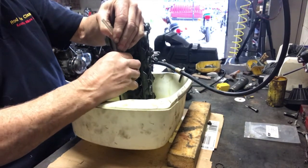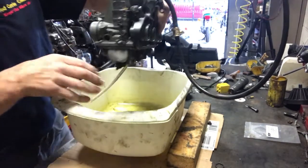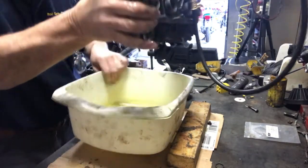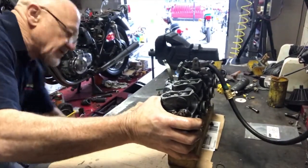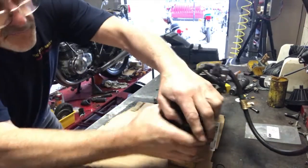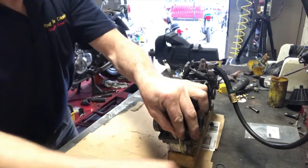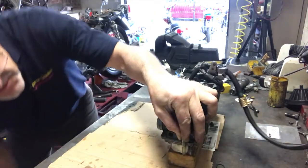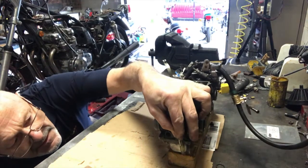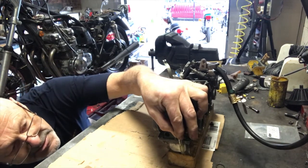Okay, once again. Oop, so I mean about it getting messy. Put that back on there. Put that back under there, and then we can use the same level on that carburetor for the one further along, because gravity works the same on both. Right, put the fuel back on, and let's see if that one comes up. Blimey. That one is exactly right as well.